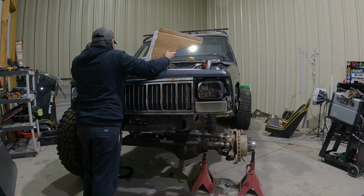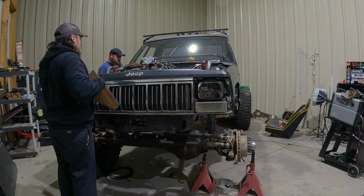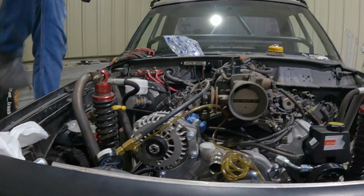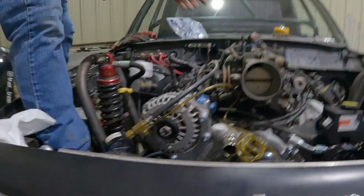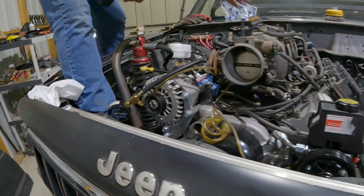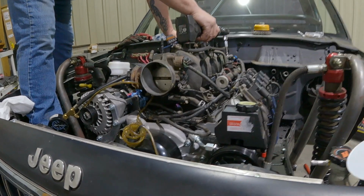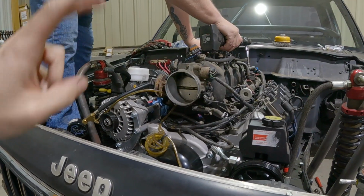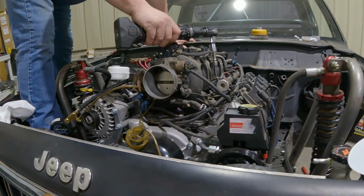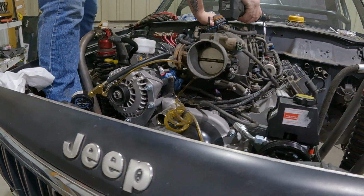What if them hoses are backwards? Question is, is the fuel pump coming on? All right, so we got fuel pressure, but we don't have enough pressure, and it doesn't hold pressure. So we're gonna break this intake manifold, pull the fuel rail up with the injectors, key on by twisting those wires together, and see if an injector's spraying just from keying on, because we don't want to hydrolock this thing.